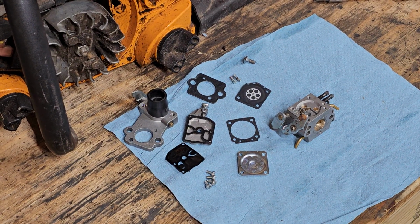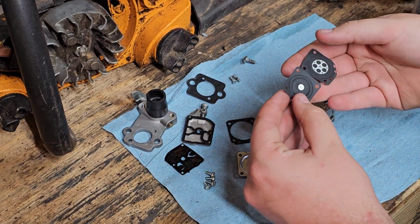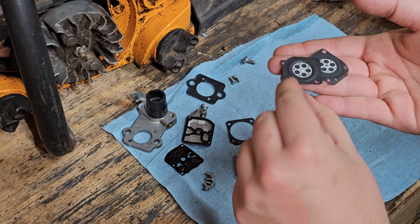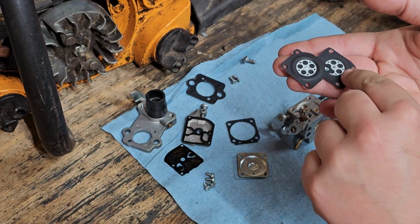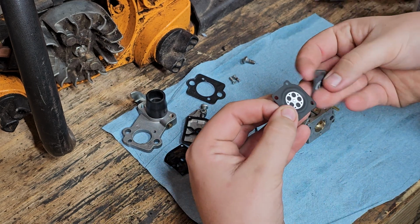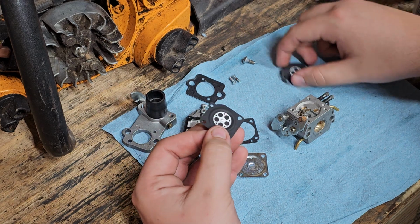Pepper. Got this. Got cleaner. Now I will say one thing about carburetors here. Sorry, wrong side. Stem size, yes, size matters. This is a short stem that came out of it, short stem going back in it. It's a different style, but it's going to work just fine, because all you got to do is just stick the screw through there and it's fine.